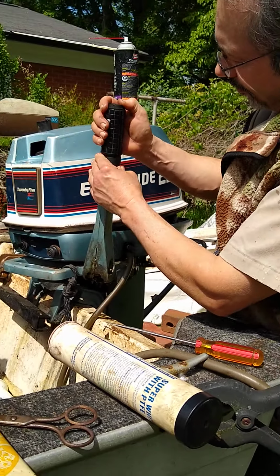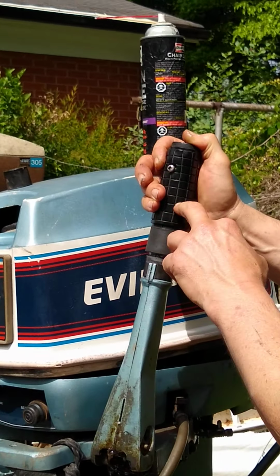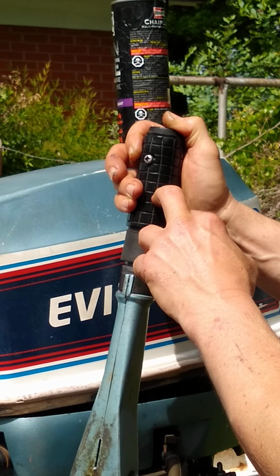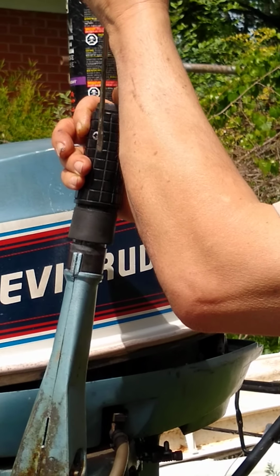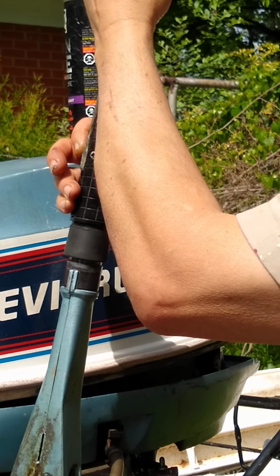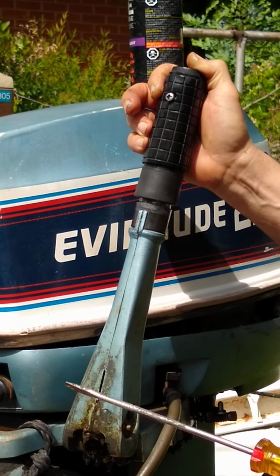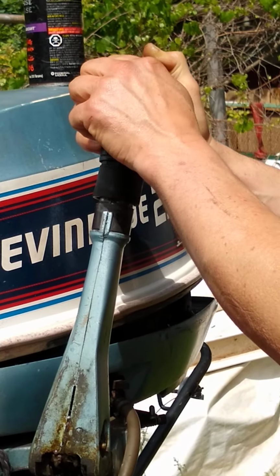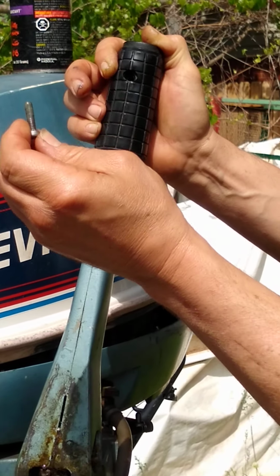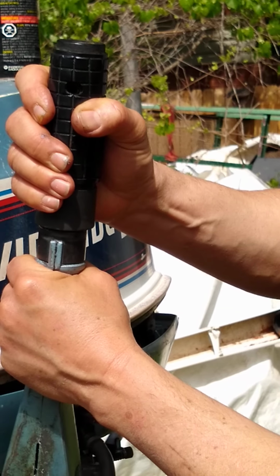But underneath here is this screw, and it can sometimes be covered over by the rubber grip. So you have to take a narrow screwdriver, put it down in there and gently loosen the rubber away from the plastic that it's attached to, and move it around a bit to uncover more of that hole that the factory put in for the screw. Then undo this screw. It's Phillips head fine thread. Okay, don't lose it.